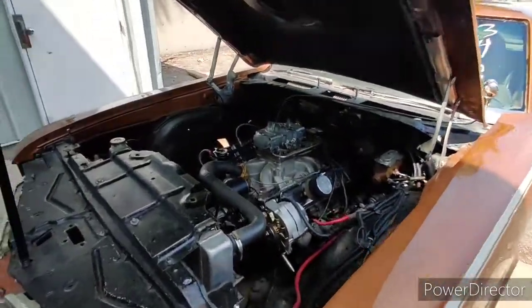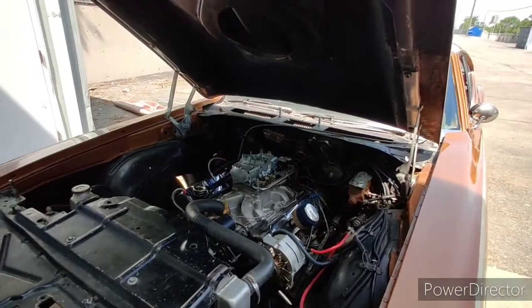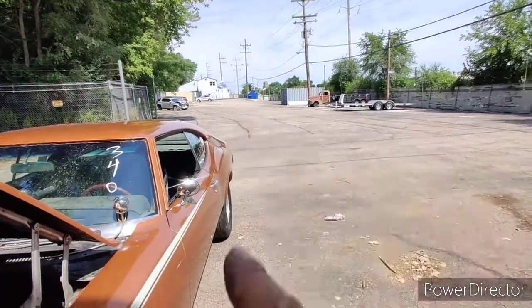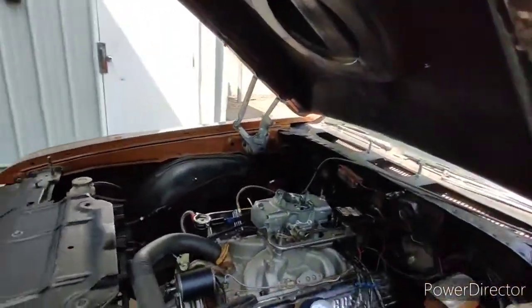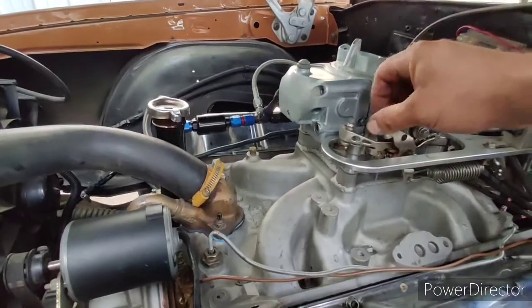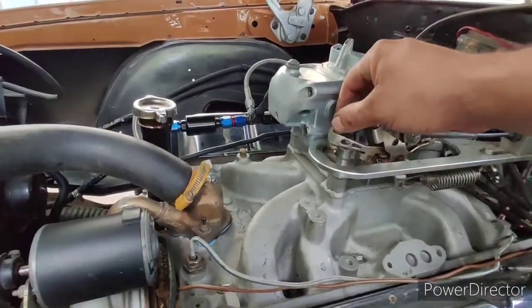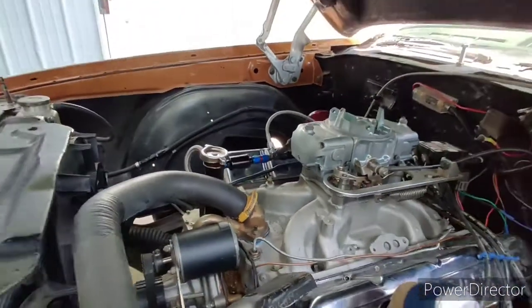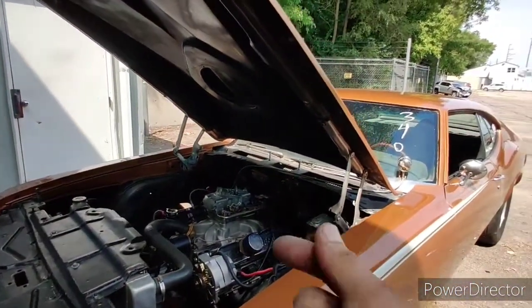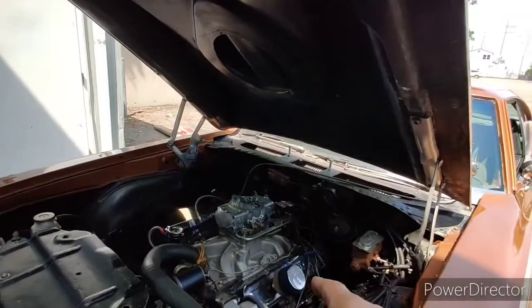Alright, so I wish I could do a pull video with me holding the phone, but I can't. But you can see off in the distance, like back there, there's two big ass tire marks. Yeah, carburetor's working pretty good. Now the only problem is I do have a slight off throttle hesitation because I changed the pump cam. This right here is giving me a serious lean spot. It's going to like 22.5 and beyond for a split second there on transition, so I got to tighten that up.